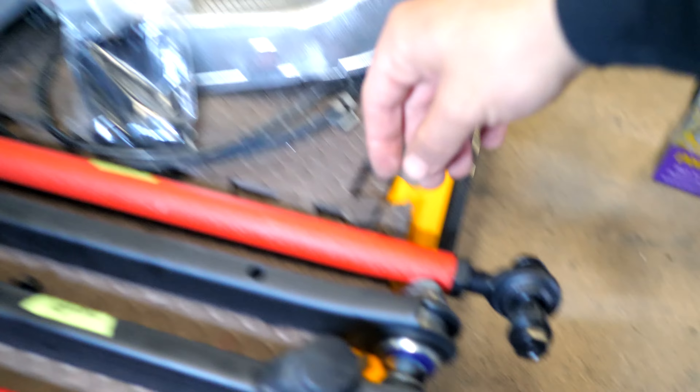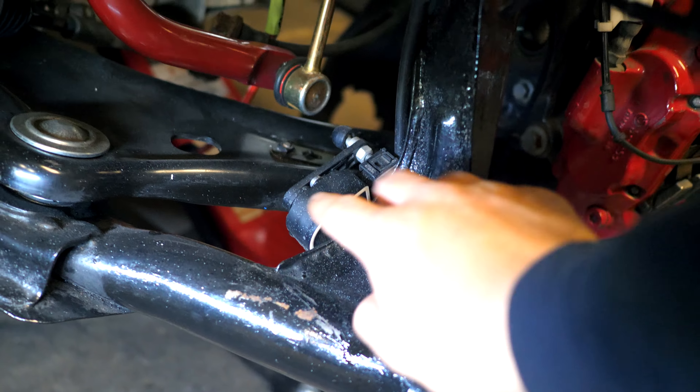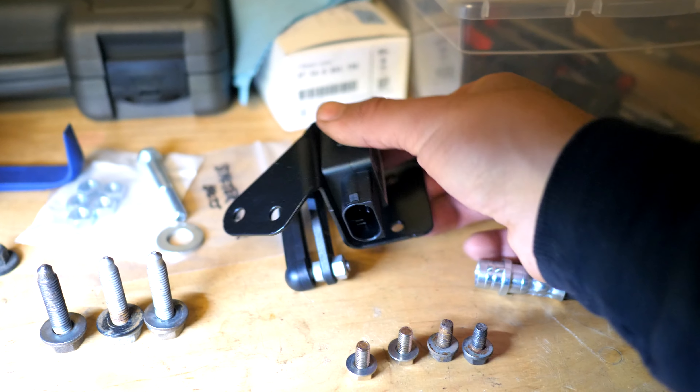While I was doing all this, I also wanted to do some control arm work. My car has adjustable control arms for the lower arms in the back of the Mini. I can't do the same thing for the upper ones because my car has projector headlights and they're auto-leveling. The auto-leveling headlight part needs to know where to auto-level to. There are two different mechanical parts on the car that tell it where to go — one found on the front control arm, and another on the rear. I bought a new one for the rear because the old one didn't exactly look too pretty.